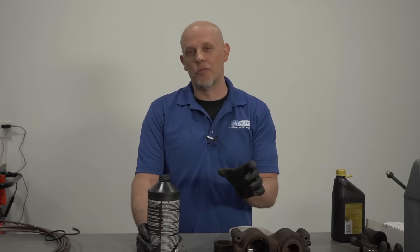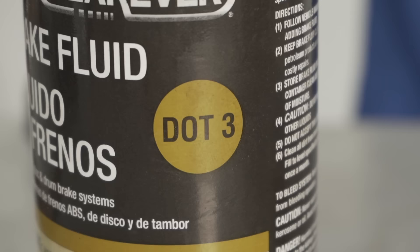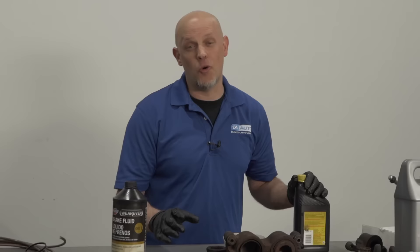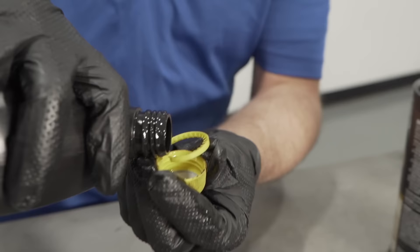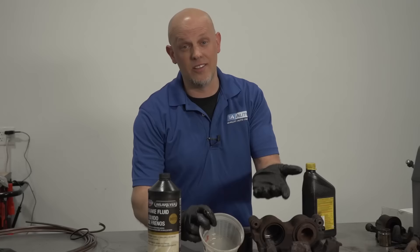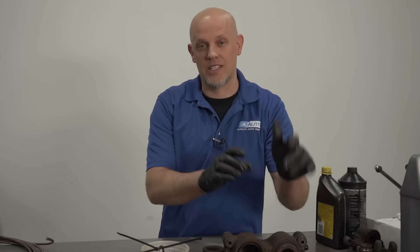Let's talk about fluid. The important thing is using the correct brake fluid required for your vehicle — normally it's on the cap, but definitely check the owner's manual. It's not a good idea to use a brake fluid bottle that's already been opened, as moisture can get in and contaminate the fluid. Most vehicles use DOT 3 or DOT 4 brake fluid. It's extremely important not to mix any other type of fluid — if you mix oil or any other lubricant in with the brake fluid, you're going to damage the entire system including the calipers, brake hoses, ABS unit, and master cylinder.